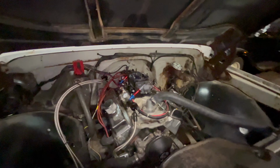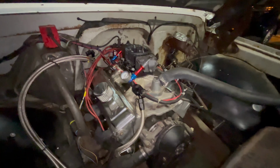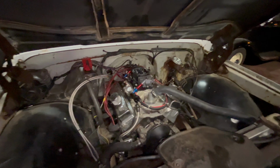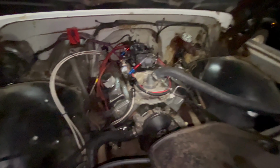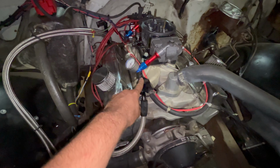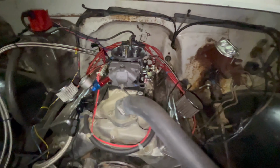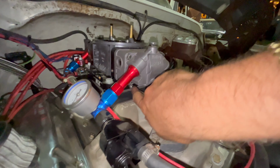Now, a lot of people get very worried about the fuel system. They think, boy, do I need an extra fuel tank or a super high performance fuel pump. If you're out in a pro mod running 500, 600 horsepower worth of nitrous, absolutely. But for your basic kits that you're gonna buy for your street car, for your mild drag and drive car, no, absolutely not. This is just kind of a mildly high performance pump. It's nothing fancy. I think it's a 110 gallon per hour pump, something along those lines. And as you can see here, it goes up into a Y, and that Y feeds the fuel solenoid for the nitrous. And then right in there is going to be where your jet goes.